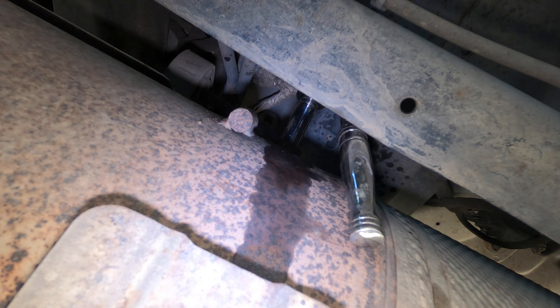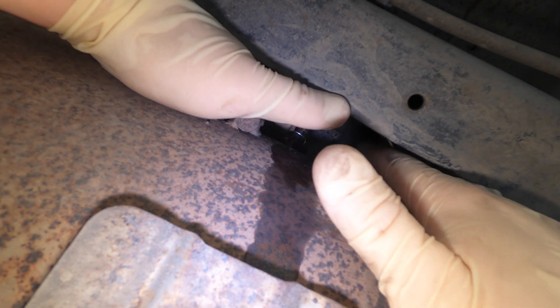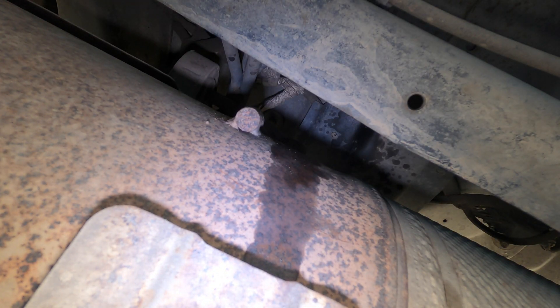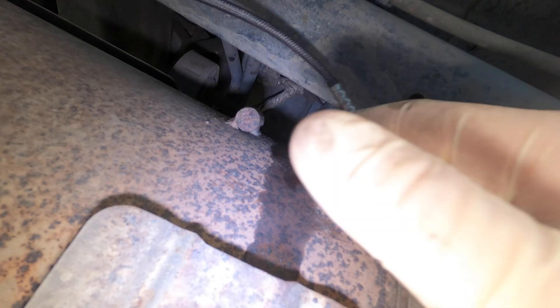This thing has been sitting for an hour and he only drove it a couple miles here, but it's still kind of toasty. The customer wanted me to do it yesterday while it was 106 degrees outside. The DPF was hot and I told him no - you have to leave it to cool down in the morning. People don't understand the exhaust - it's really hot, really fast. In the span of 30 seconds a cat can be three or four hundred degrees. These sensors are all the same according to Ford.